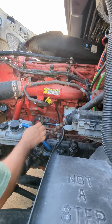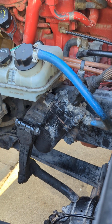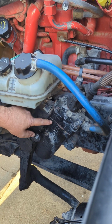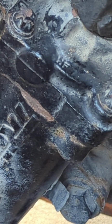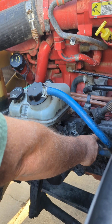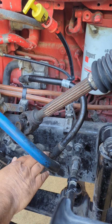All right. And then finally, to my power steering gearbox, it's properly mounted, secured, not cracked, bent, or broken. It also is gear driven, and it's not leaking. Okay. It would be leaking from this seal right here or from a possible crack. All right, since I'm right here, staring right at me is that frame. Properly mounted, secured, not cracked, bent, or broken, no illegal welds.